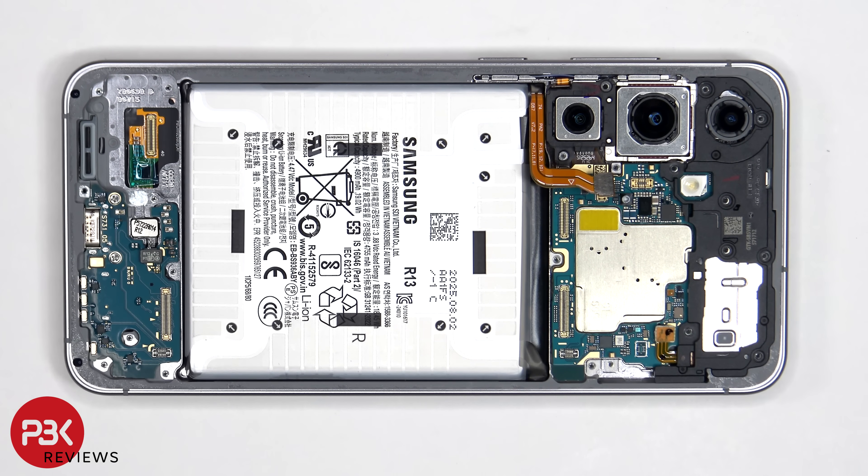To remove the battery, there's a pull pouch which is holding the battery down. The tabs can be peeled off the battery at the marked locations indicated by the arrows, which will release the battery and allow you to pull it out.